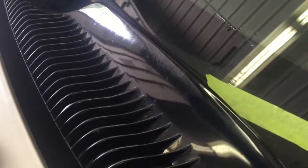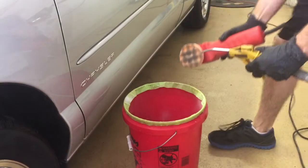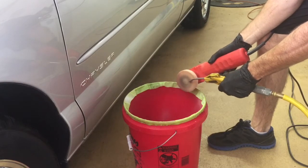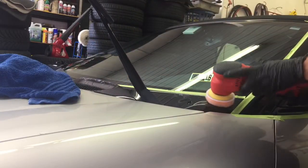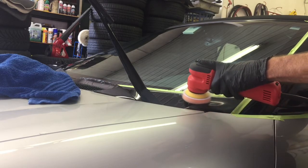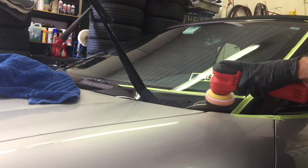In here we have fading, oxidation, some staining, and also a little bit of the clear starting to break away and chip off here and there. We're going to blend all that in. Before we add product, we have to clean off the pads — forced air or a dedicated brush. I would normally remove the wiper arms altogether, but I flipped them up and I can get my fingers in between the base and the wiper motor covers, so I'm just going to leave them on and save a little time.